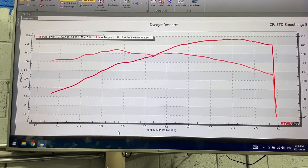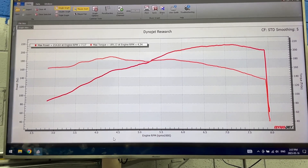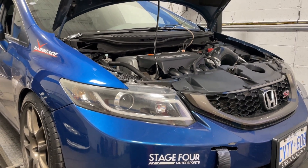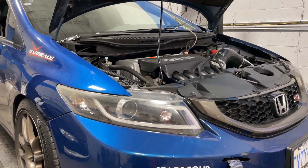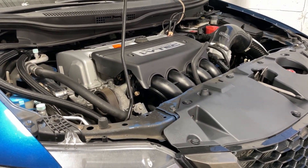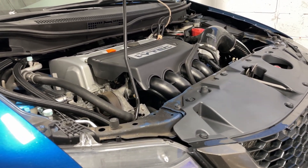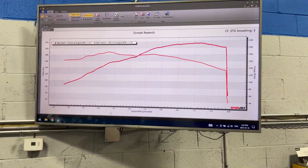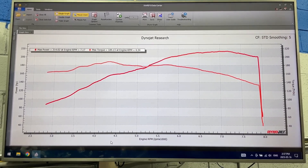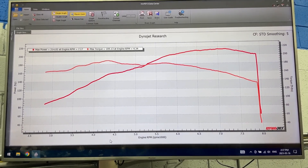What you do get in exchange is a whole bunch of mid-range power. By comparison to going full bolt-on on one of these 9th gen SIs — because this engine is basically full bolt-on — except it doesn't have what most people put on it, which is the RBC intake manifold. That RBC intake manifold is usually a trade-off: you get more peak horsepower but you lose a lot of mid-range. And as you can see in this graph, there's a ton of mid-range. Let me bring up a dyno graph of a full bolt-on car with stock cams but with an RBC intake manifold.